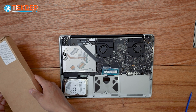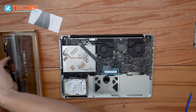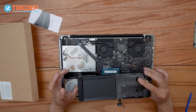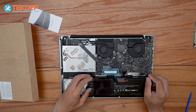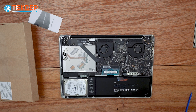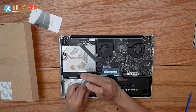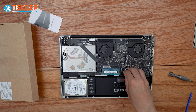We're gonna unbox our battery — again, if you're looking for these or the trackpad, we have them in the description below or on our website. Unlike more modern MacBooks, there are no adhesive strips to worry about on this one, just protective covers that we remove. The battery slides down and lays into place. We'll grab the tri-wing again and secure the battery to the top case — these screws will bottom out, so just tight enough that the battery is not loose and flopping around. Now we plug in the battery connector.